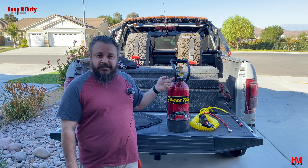My son is going to help us out to show you guys how to properly use these. There is a process in order to use these correctly — both how to charge it and how to discharge it. You'll notice you're going to have two valves: your main valve to open up the tank and let the CO2 out, and then your regulator valve up here. Both of them play a different role. Let's go ahead and get this connected and then we're going to show you what to do.